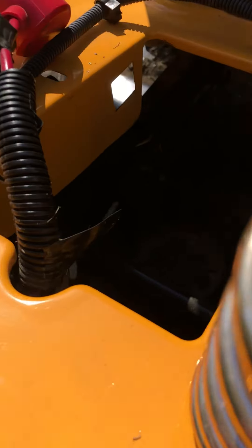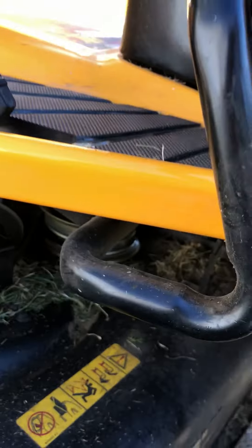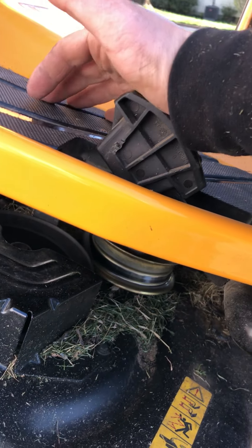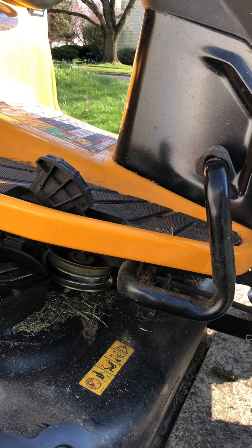Mine doesn't have any leaking or physical damage. Grass had built up in the back of the pedal assembly inside the frame right here — it's not letting you press the reverse all the way. Mine felt like it had a short stroke to it, and I was right. Started digging around and it was backed up with grass. Hopefully that helps you guys out.